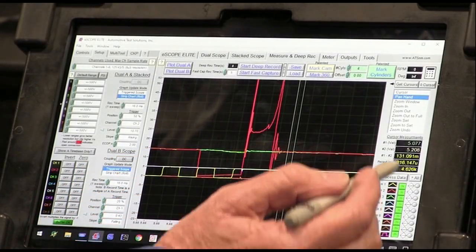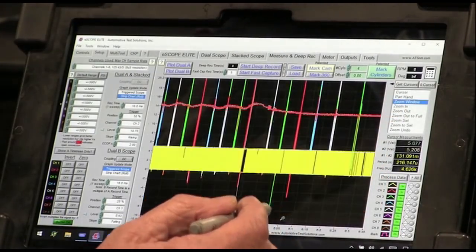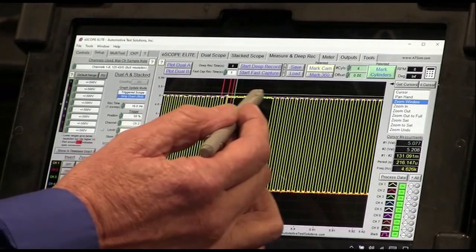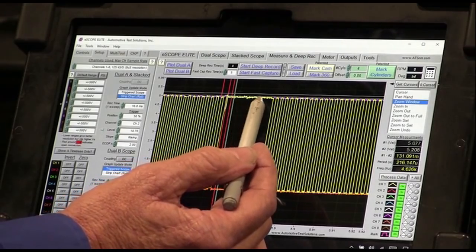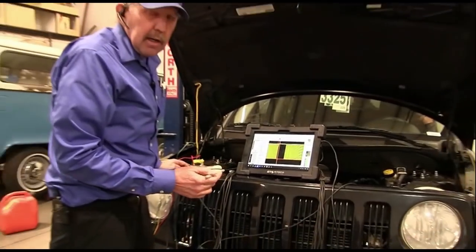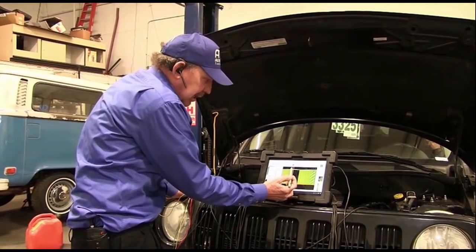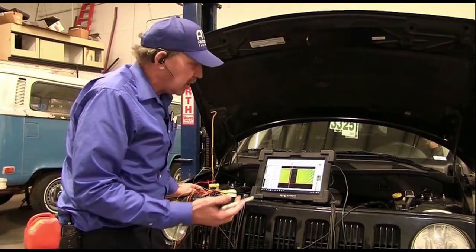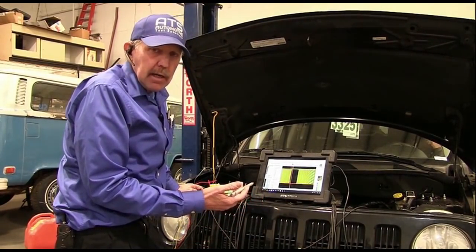And then right after this is where we see the crank sensor failing, and it's failing high. The computer did its job. It has 5 volts. Okay, guys, this has a new computer in it. Now, you know this cannot be the computer. The computer did its job. It put 5 volts out. Don't put a computer on for this, because you're going to waste all that effort and money. It's not going to fix it.